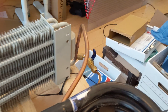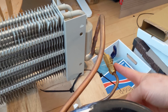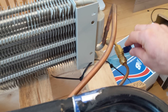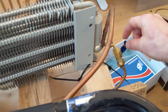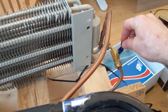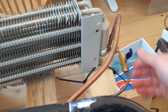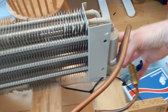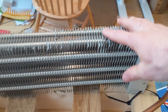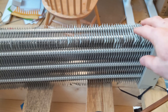You will not see this on many air conditioners — here is the orifice. It's really just a ball valve, and the way you adjust it is while it's running you just do this until you get exactly the right amount of metered flow from the high side to the low side into the evaporator. And it's almost impossible to get it even close. The best you can hope to do is adjust it so that you get a big block of ice right here.